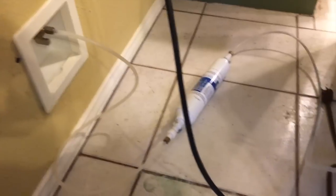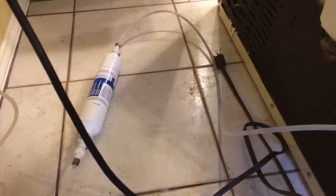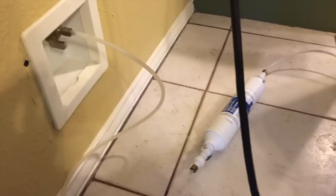For this maintenance item, you want to make sure your refrigerator is off — I've got mine unplugged, you can see the cord laying there next to the water line. Before changing your filter, you also want to make sure the water supply is off. Mine is just a small valve in the wall, and you simply turn the on/off knob crossways of the line — as you can see, that is in the off position. You're still going to get a little water that's in the line, so it's a good idea to have a bucket handy, like this small two-gallon bucket, which will also come in handy when flushing the new filter.